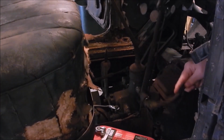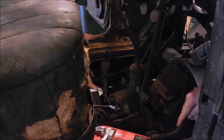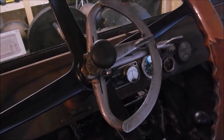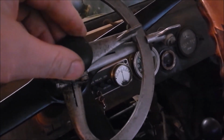Any sparks when I go like this? No. Don't smell any smoke. Of course, nothing's on. If I don't smell smoke in 5 seconds, I'm going to put this terminal actually on. The only sign of life this car has is the horn works, and the ammeter works when the horn... Watch the ammeter over there. See it jiggling?